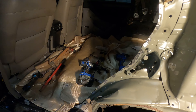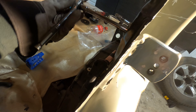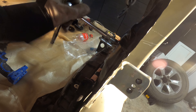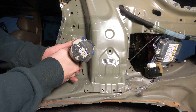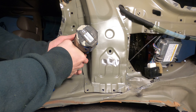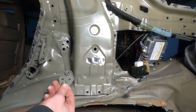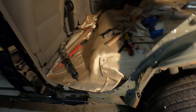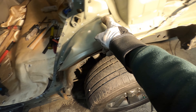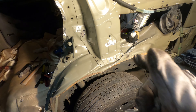Let's go ahead and move on to over here. We also have to drill these two out that are holding this latch, so let's actually remove this latch really quick — they're just bolts from the inside as you guys can see. Now let's drill this out. This piece is still nice so I'm going to save it in case I need to reuse it. Instead of drilling these ones out right here, I'm going to sand them out from the backside. So basically all these X's mean I'm going to sand the spot weld out — all the way across and down there.